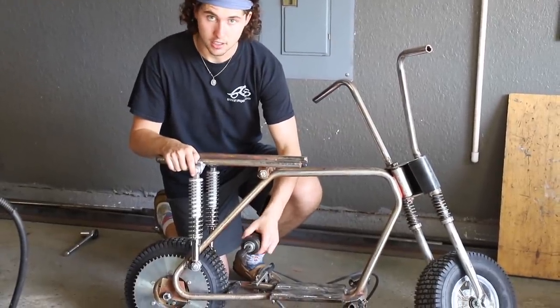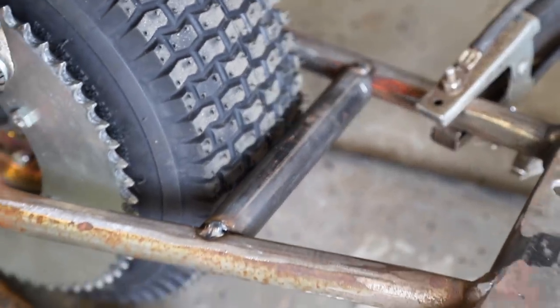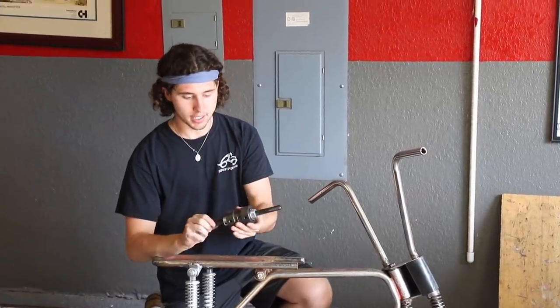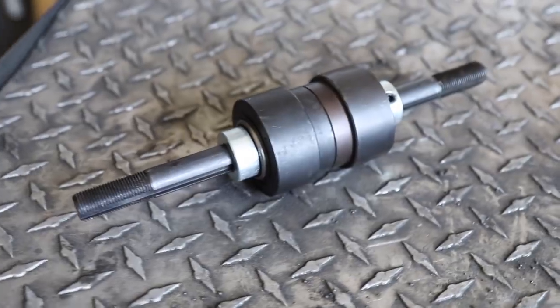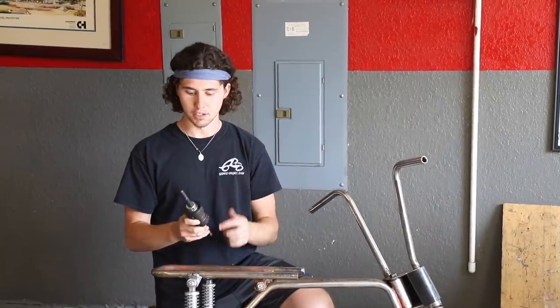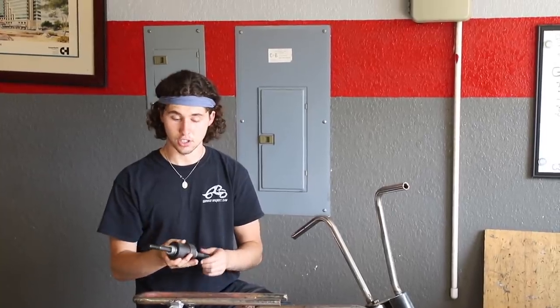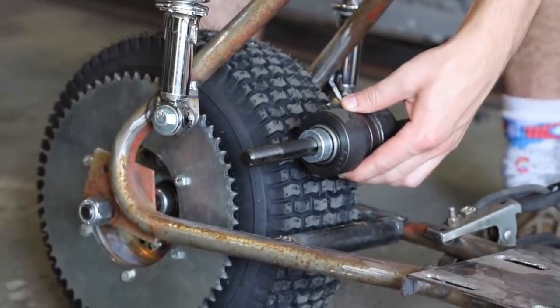I hope you can get an idea of what's going on here. We added this bar right up in here, and that's basically going to be our carrier mount for the jack shaft. I call this a carrier because it's actually super beefy — we kind of went overkill, but I do like how strong it is. These are actually those weld-on things you get at a tractor supply store that you weld a little sprocket to. It fits our 5A bearings perfectly and it looks like a giant carrier, like a center section. I'm going to weld these two together, then weld our lifters up to bring it to height, and that's that for the jack shaft.